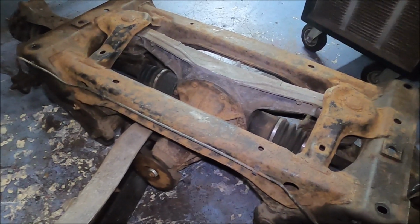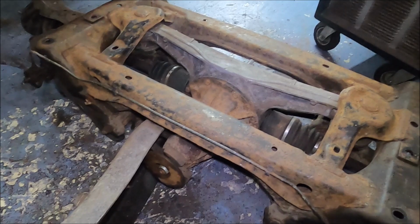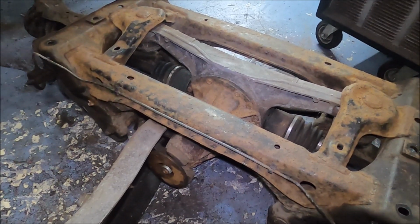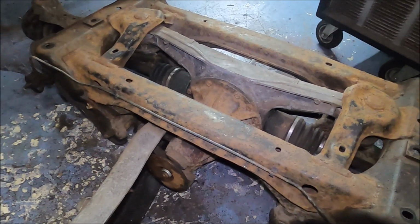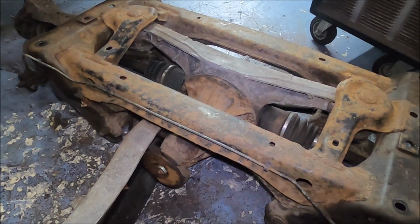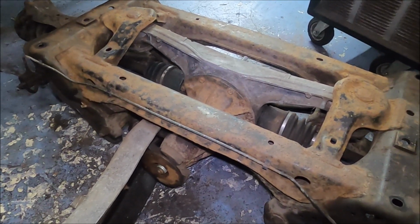I mean, my 940 has got a 3.54 rear end. I know from experience of doing it to other cars, you go from like a 3.5 or so to a low 4s, and it's like night and day difference in acceleration. Like, it's a different car. It feels like you've added 30 plus horsepower. More than that, actually. It is a different car in acceleration. So, yeah, mine's 3.54 in the Volvo.